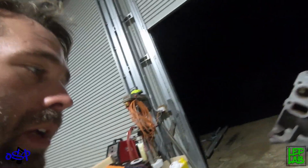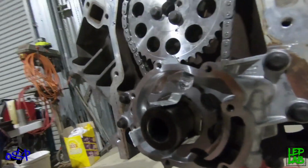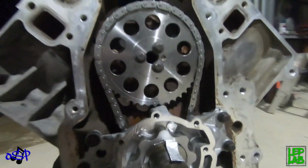Alfoil, as I recently discovered when I measured it, is about half a thou. So with a few folds, we've managed to get the thickness we need. It's not real professional and doesn't look great, but it'll do the job.